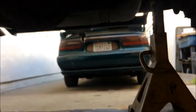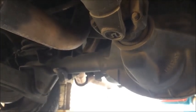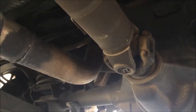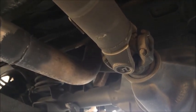that side. I did forget to mention that the Jeep is up rather high on jack stands right now. I have four of them holding the Jeep in position. Something you definitely want to do before beginning this project, because we're going to need a lot of room to get the transmission out from underneath the vehicle.